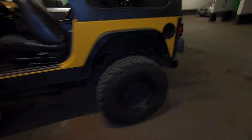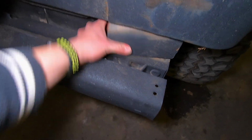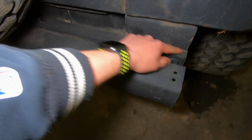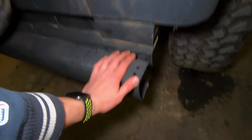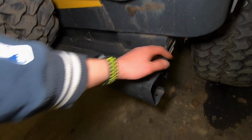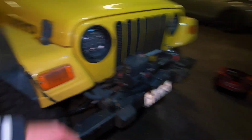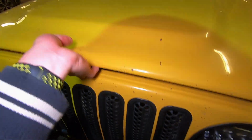Now, on to the next thing that I broke. The other body mount. So this body mount, you can see is spinning. So we're gonna have to get a tack weld on this one, or a full weld, whatever I can manage to get. I need to go to a shop. If I go to a shop, I'm gonna get a full weld, obviously, but if I have to do it quick somewhere, then we'll just tack it up, whatever we need to do to get it done. Now, I'm gonna replace the winch, but we also need to replace the radiator.